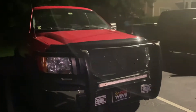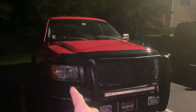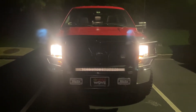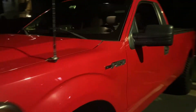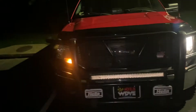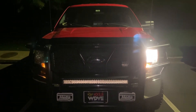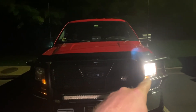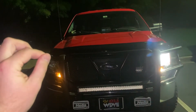We are going to be changing both headlight bulbs. The reason is because the high beam on one bulb is out. Both low beams are on, so you could still drive the truck at night using low beams the whole time. But when you put the high beam on, that light is completely out — it's just a bad bulb. If it were a wiring issue, relay, or fuse, both lights would be out. Because this high beam still works and the other does not, that tells me 99.99 percent it's the bulb.